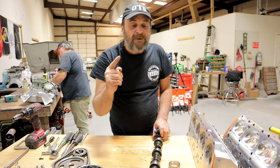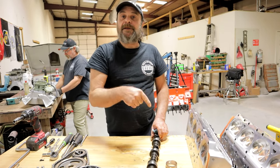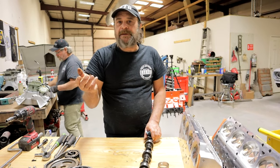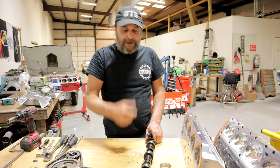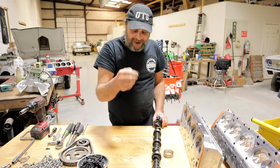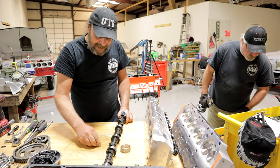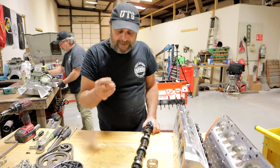There's the lesson for the home builder, for the new guy who's just getting started. You cannot overlook anything. When you're putting these engines together, you've got to go slow. After you do this for a while it becomes second nature — you just automatically blow through or squirt through and make sure all of the oil passages are clear before you put it together. The importance is to clean everything, because they always don't do it at the factory. Check everything. I'll see you tomorrow.